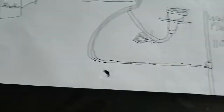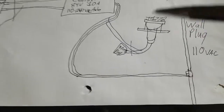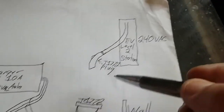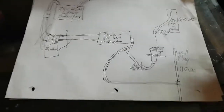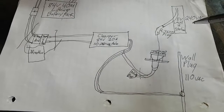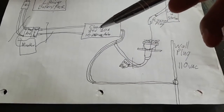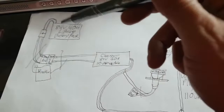Don't plug them both in at the same time. Now you can either have your 110 plugged in, or if you don't want to use your 110, you can go up to your EV 240 station and plug your J plug into it. So you've got two cords coming out the plug side - you can either get your voltage from your Level 2 station or from a wall. They both come into the charger, and when you flick the breaker it turns the charger on and starts charging the battery.